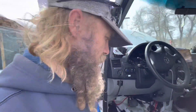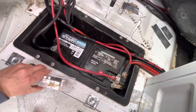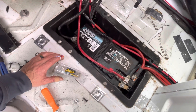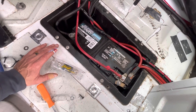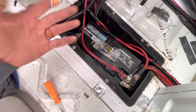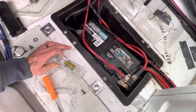The starter battery is underneath the floor panel on this 2016 2500, and there was a fuse in there. When troubleshooting - if something's not working, you're not getting power like he was experiencing, it wasn't starting - you need to troubleshoot that. It's a real pain if there's a fuse hidden underneath a metal floor panel where you have to pull up the carpet, pull up the sound insulation, take tools out, and pull off the metal plate just to see if the fuse is blown. That's just not good design.